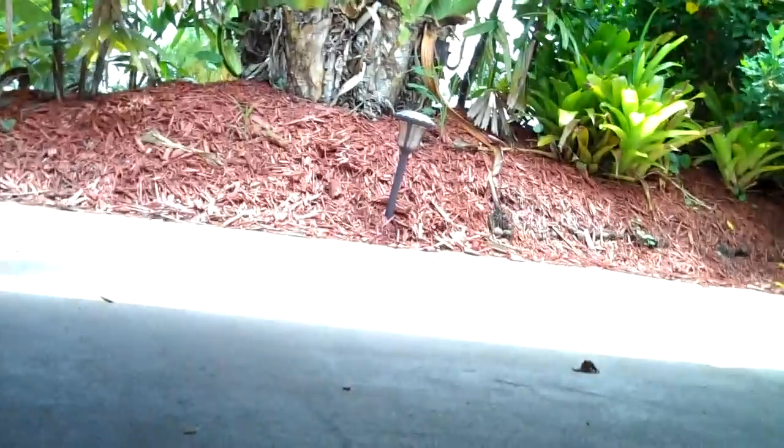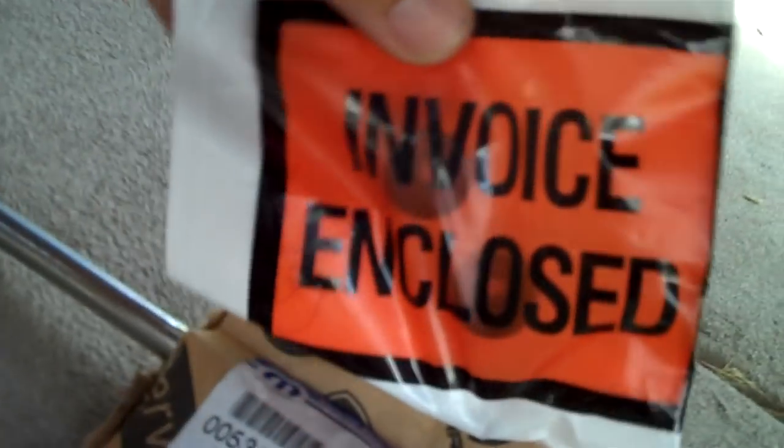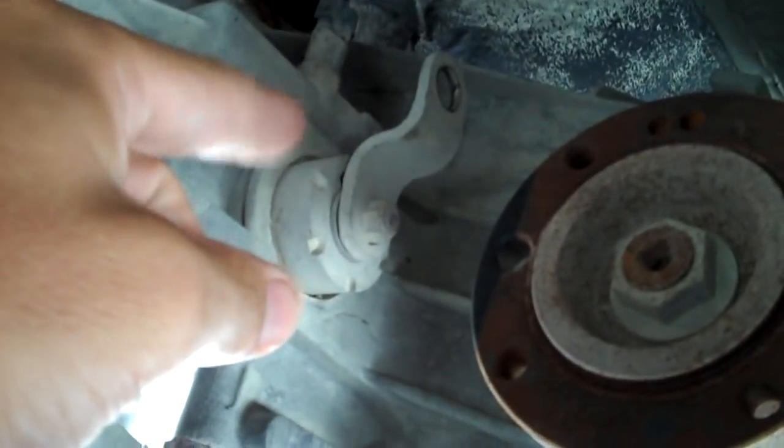You don't have to take your drive shaft off, but I just took it off to make it easier to see. What you're going to need to order is a transfer case linkage and two bushings. What happens, from what I understand, is the bushing back there rots out, the linkage falls down and hangs, bangs around, and then just wears out the other bushing.